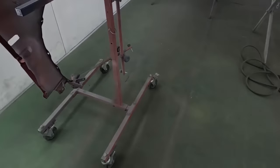Now for this particular top coat that is tinted, you only have to really apply 2 to 3 coats if you're doing an all over spray job. For our case, I like the way it looked just after 2 coats, but keep in mind, if you're purchasing this paint to match something, you're going to need to do a spray out card ahead of time to see how many coats you'll need to appropriately cover.